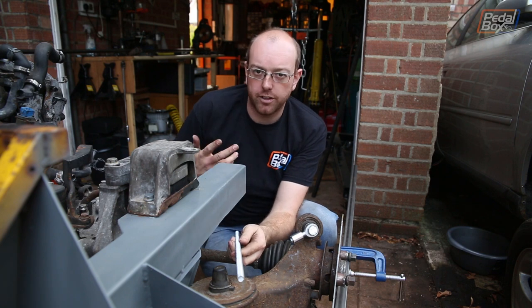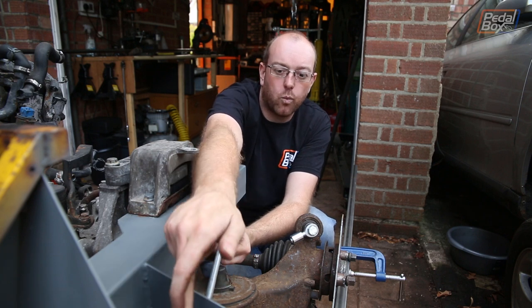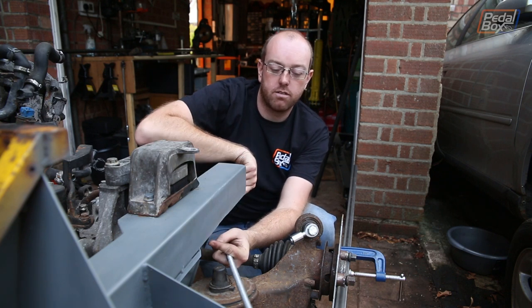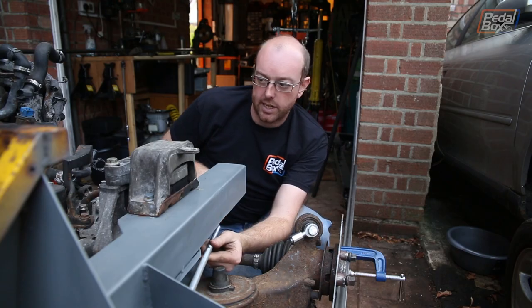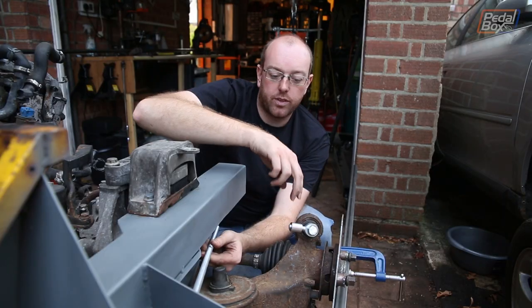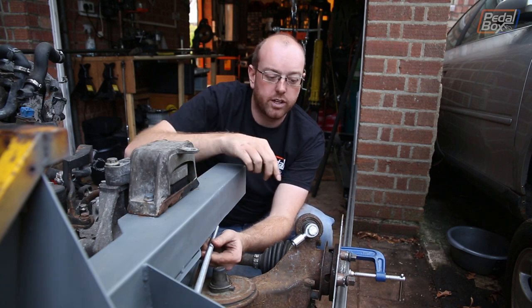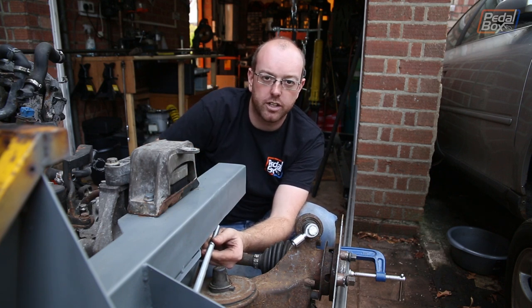Chris had an epiphany: the pivot point of our trailing arm at the front is one of three points of the triangle. This is one point, the second point is here, and the third is the average of where we're going to have the two upper suspension arms join. Using a bit of rod approximately in line, we can work out roughly where we need to bring this arm to. The front arm is pretty much a straight line — we don't need to bend around anything — so we get that one done, then look at the back once we put the suspension turret in.